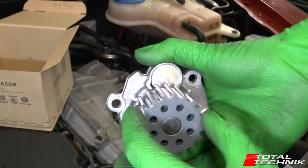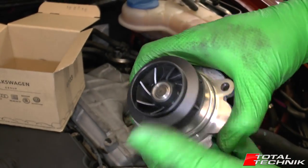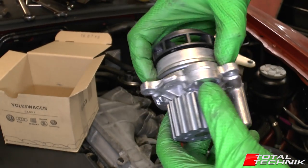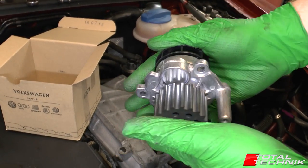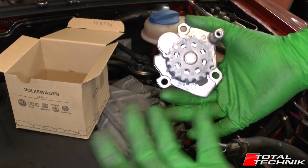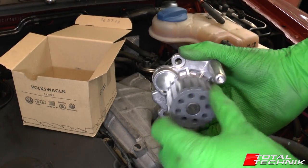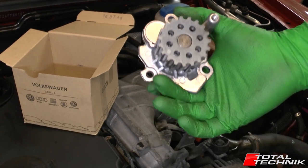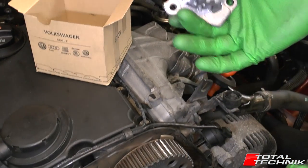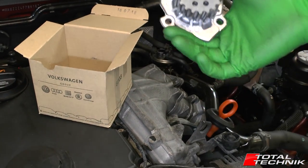Looking at the water pump on these — really simple units, basically just a big bearing. The cam belt drives it, which spins a little fan arrangement that pumps coolant through the system. Not everyone replaces the water pump, but because they're so simple they're quite cheap — genuine Audi ones are around £40-£45 ($60), non-genuine from around £25 ($35). If you're going to the hassle of removing your cam belt anyway, you have to remove it to change the water pump, so this is the perfect opportunity. Optional, but well recommended.